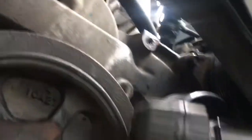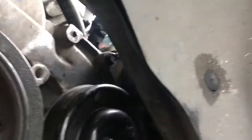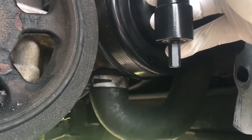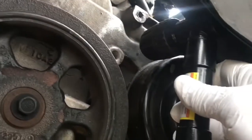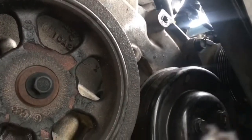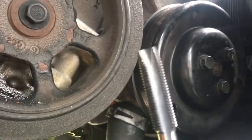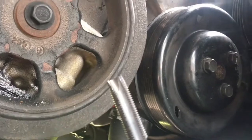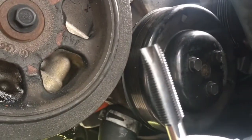I tried to get a drill bit in there with this extension and still couldn't get a nub on it — it's a little long. I couldn't drill out that hole, but I'm just going to tap it anyway. I got a slightly bigger tap — about one and a half to two millimeters bigger than the screw I pulled out of there. I'm going to try that.